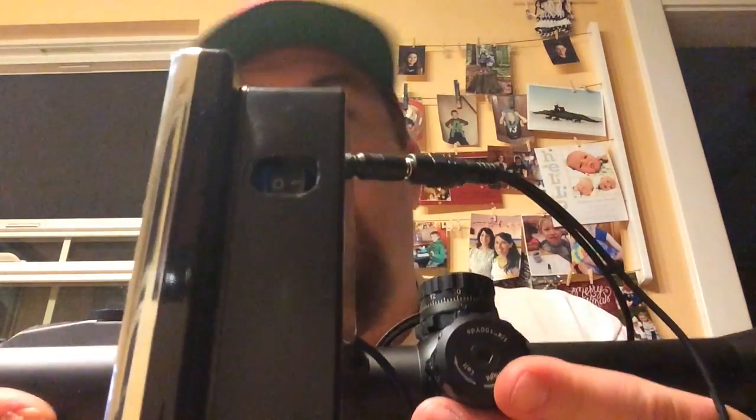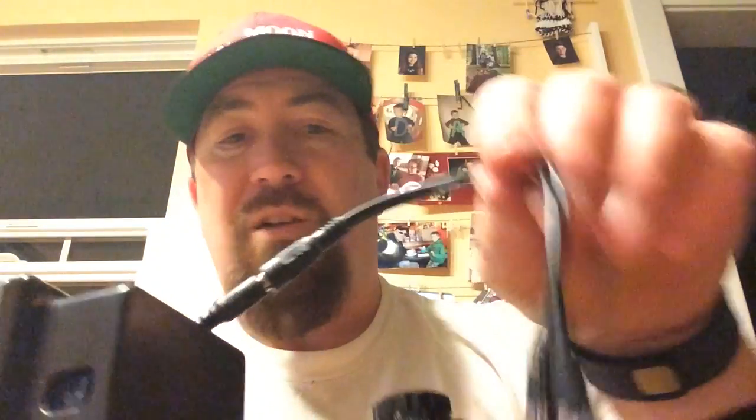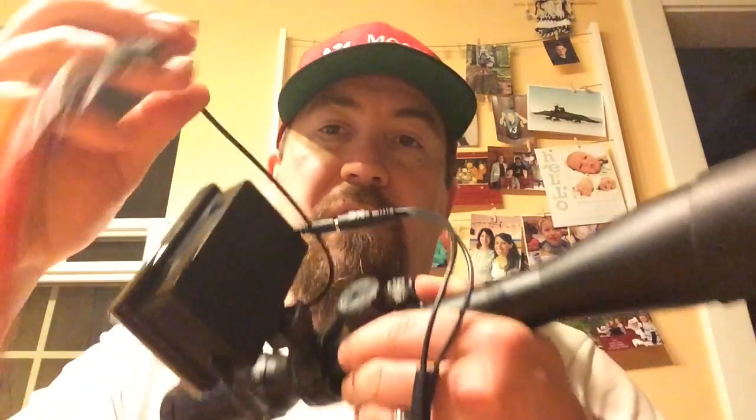If you want to record video with the DVR, you kind of have to have the screen up on top with the orientation right, or else you're going to be watching your video sideways on your computer, which is a little awkward. But I just thought I'd share that so you could see the final product, and I think it worked out really really well. You do have to clean up the wires a little bit — just a little bit of velcro, twist ties, rubber bands, or electrical tape to take all the slack out and bundle them behind the unit. I'm all about function, not aesthetics.